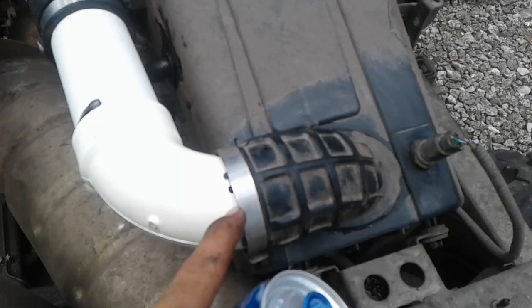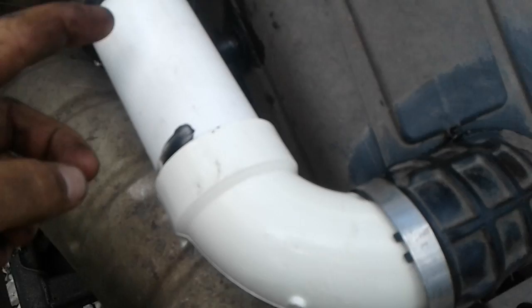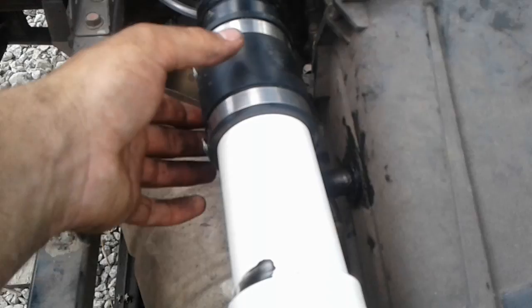So this is where it goes into the airbox. You've got a street 2-inch 90, a regular 90, a 5-inch piece of 2-inch pipe, a 2-inch rubber coupler — so it takes out vibration and makes it so you can take the snorkel off. About a 2-inch piece of pipe just to get from here to the coupler. A street 45 into a vent 45 into a regular 90.